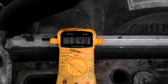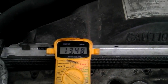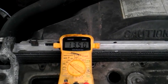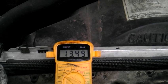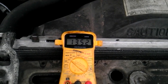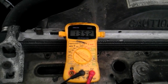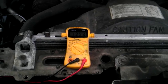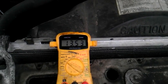Charging systems do take 12 volts, so as long as it's over 12 your car is not going to die on you, but this is only half the test. You want to be up around 13.5 to 14.5 at idle. If it's sitting under 13 volts at idle you probably have a bad alternator, but this is where the real testing comes in.